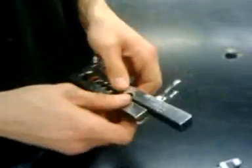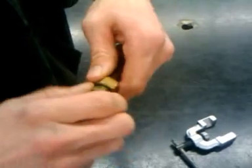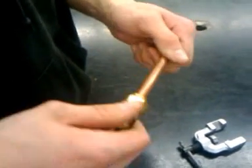Back it off, and you might need this to break the nuts loose. Then you take your flaring nut, put it over the flare, take your flaring fitting, tighten it up — make sure it's really tight. Wouldn't be bad to get two channel locks: put a channel lock on the nut, put a channel lock on the flaring fitting, tighten them up, and you're done.